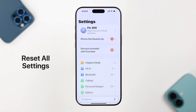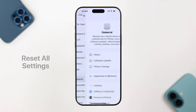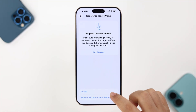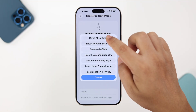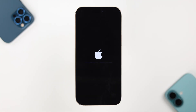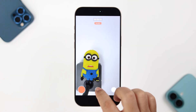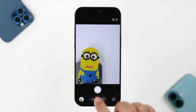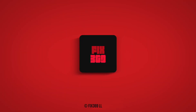If that still didn't work, the next and last solution will definitely work: Reset All Settings. Go to Settings, then General, scroll down to Transfer or Reset iPhone, tap Reset, then tap Reset All Settings. This will not delete any data, but make sure you have your Wi-Fi password saved as it will be removed. After the reset, if there's no hardware issue, your camera will definitely come out of the black screen and work just fine. Let us know in the comments if that worked — thanks for watching.